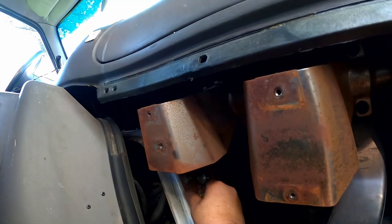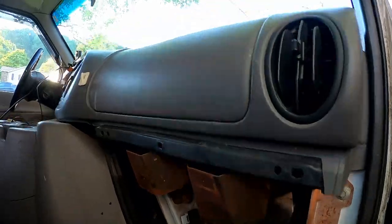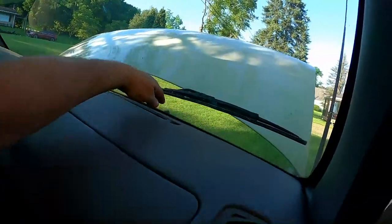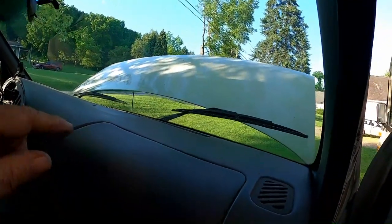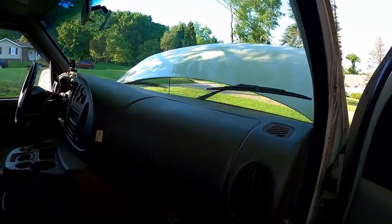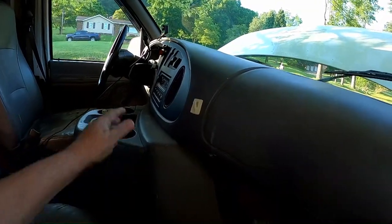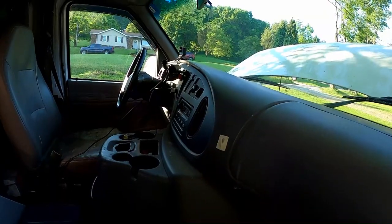The other thing I want to mention: I didn't think the air conditioner in the van worked at all, but it turns out it does. You couldn't notice it because nothing came out of the vents. I knew the defrosters worked, and when I had the AC on one day I reached way up and the air was cool — not as cold as it should be, but definitely cool. So the AC system might need some refrigerant added. I want to get it blowing out of the vents first, then put a thermometer in there and check the temperature.